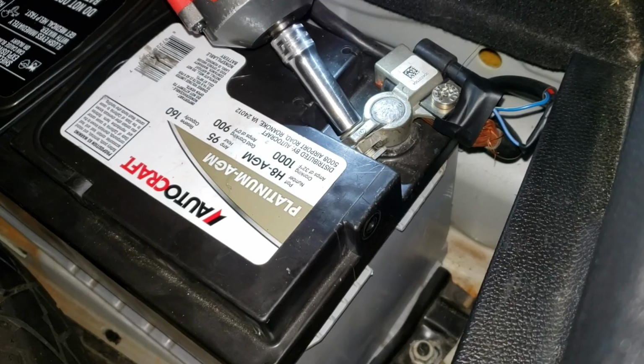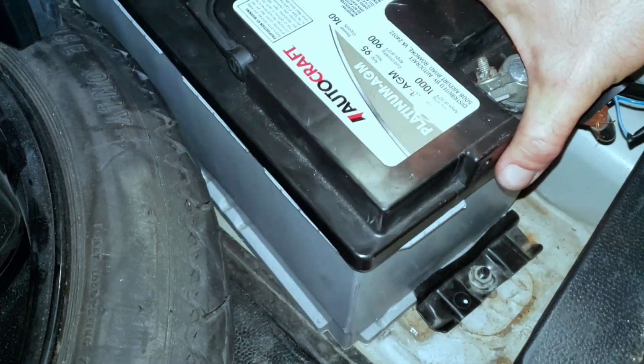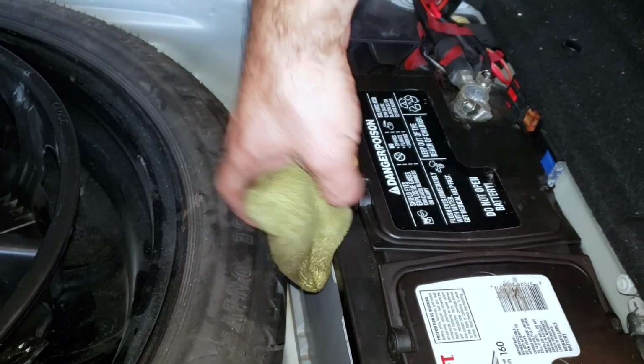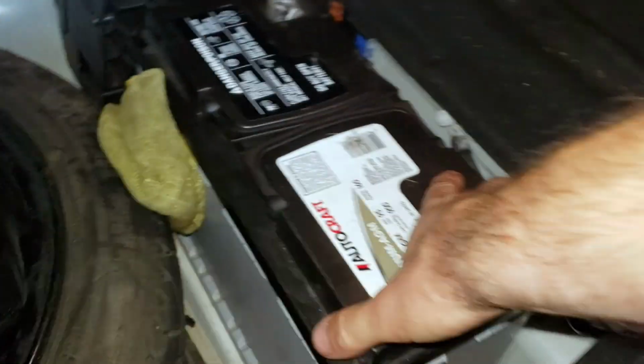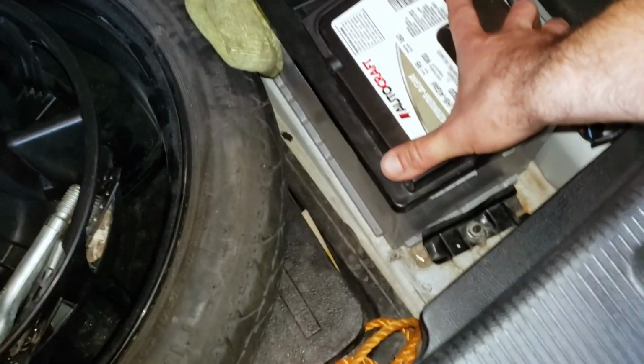Now, the reason the wire broke was from the battery not being held down properly due to a mangled hold down, so that's on order too. For the meantime, this dirty microfiber jammed against the spare tire should do a great job, and now that the sensor can tell the car's computer the battery's state of charge, I'm hoping the red battery light won't come back.